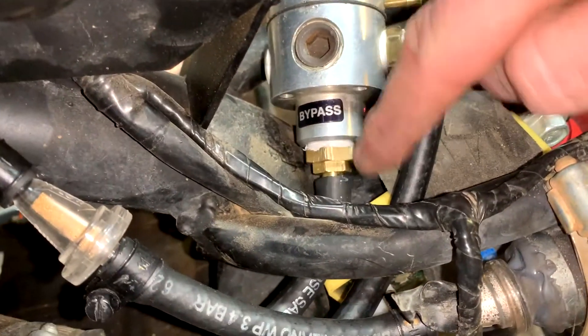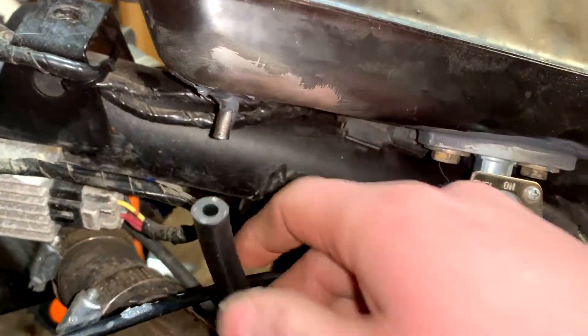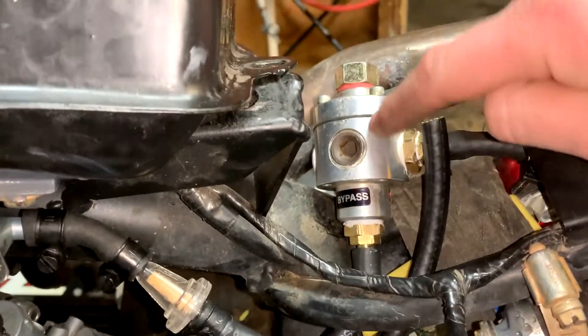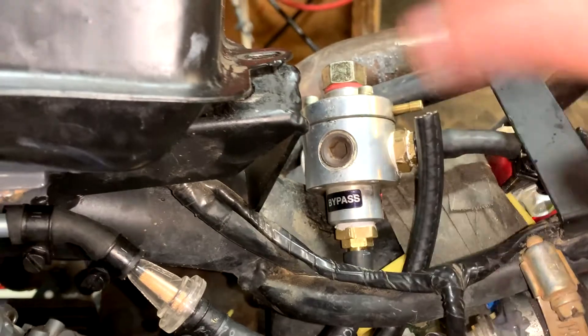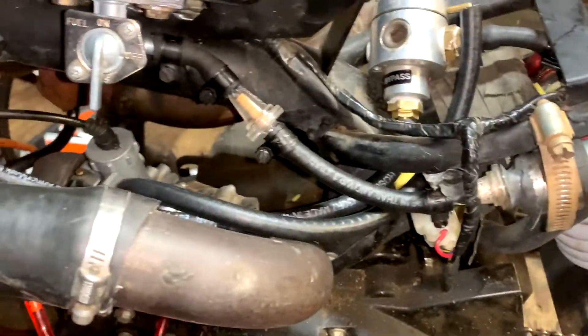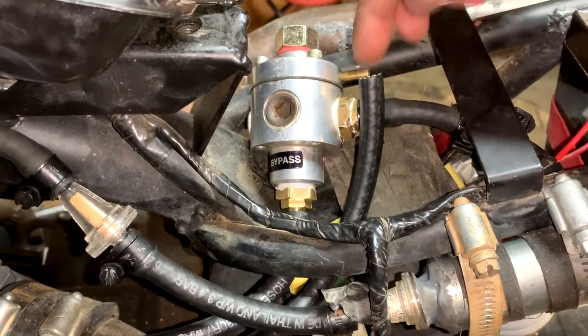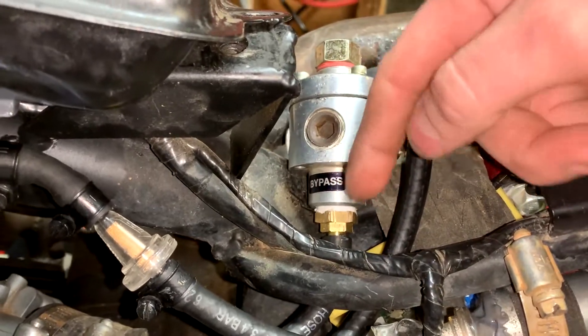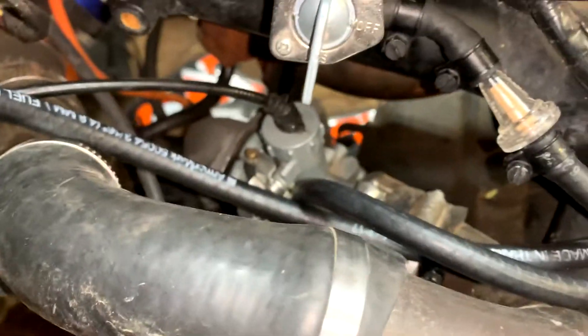Usually you want to tap off the other side of the fuel pressure regulator, but either way it's still going to do the same thing because it'll be bypassing fuel regardless. The bypass - or return - line goes back to a nipple on the gas tank, and that should give me regulated fuel pressure. I removed the spring from the regulator so it can bypass as much gasoline back to the fuel tank as possible. Once there's boost - maybe 3 to 5 PSI - it'll push the plunger down and still let some fuel bypass, but not a whole lot, because this fuel pump is capable of about 35 PSI and I don't want that going to the needle and seat or it would flood the carburetor.